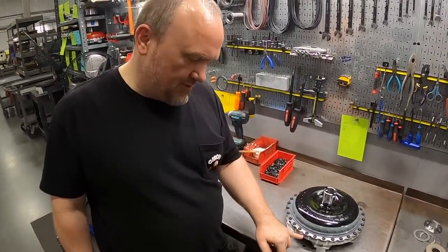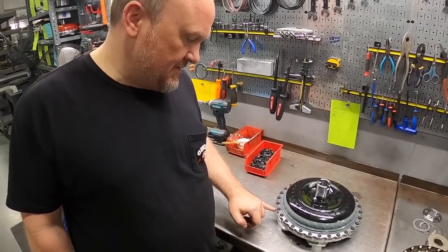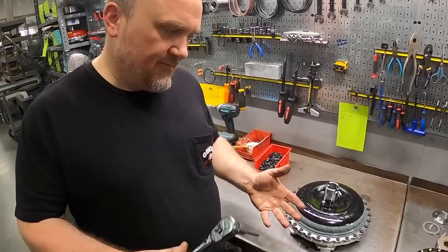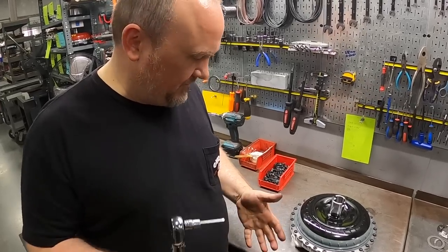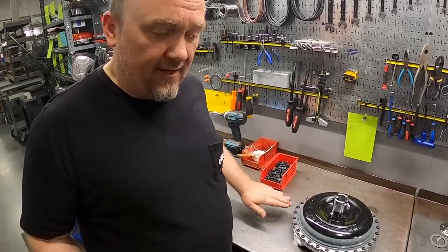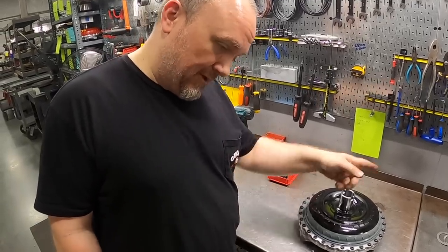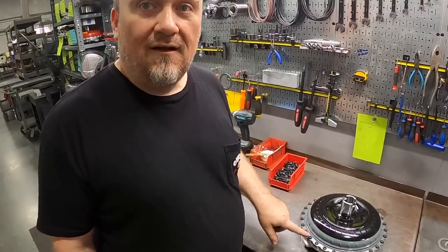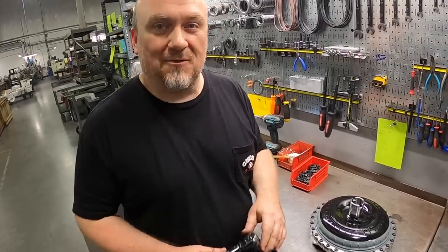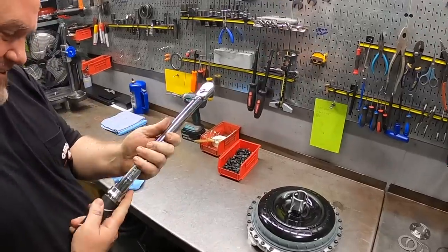Because these are precision machined flanges, parallel flat surfaces, once they're seated very precisely together in terms of maintaining flatness. So, I mean, sure, you could do a star pattern if you wanted to work your way out through 30 fasteners on how to do that. I don't personally have the mental capacity to do that, and I've never had a problem doing it this way. That is the most politically correct answer you'll get. It doesn't matter.